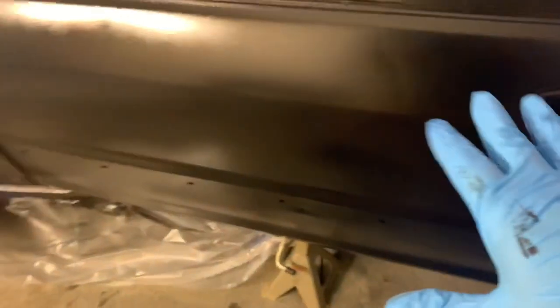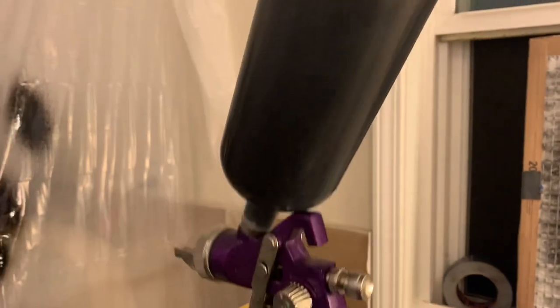It's probably going to have a pretty bad reaction, but hopefully I can just throw a few more coats on there and save it. This filter is working great. I painted the side mirrors — first tacky coat. The second coat laid on pretty good, honestly. I adjusted the gun a couple more times and it seems to be doing the trick. I think I got some paint left in here so I'll mix up another batch, pour it in, let it flash for a bit, hit it with another coat, and call it a night.